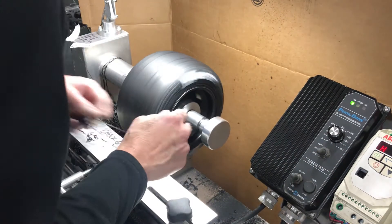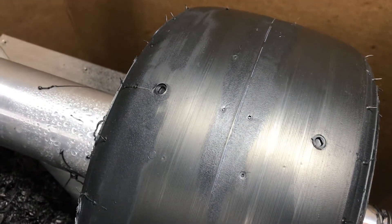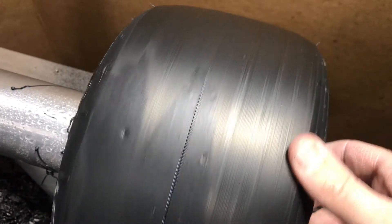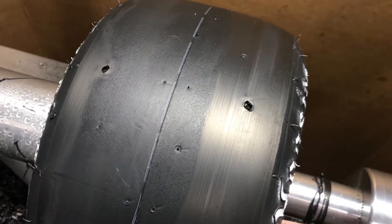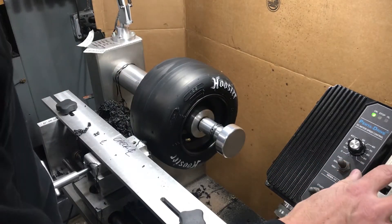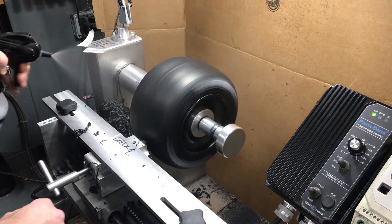Let's turn this off and see where we're at. Here's our cut tire — you can see those wear bars look like they're brand new. This is how much out of round it is; you can see those wear bars are cut down, that's a pretty flat surface right there, and then you go into an uneven surface again. There's our cut surface again. We got this tire cut, and I don't want to take any more off because the more tread we take off, the less tread we have — so now we're going to sand it smooth.